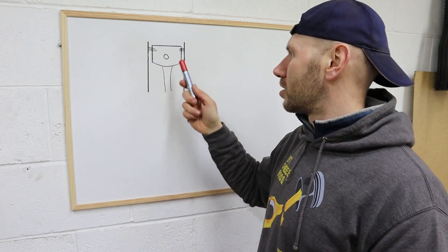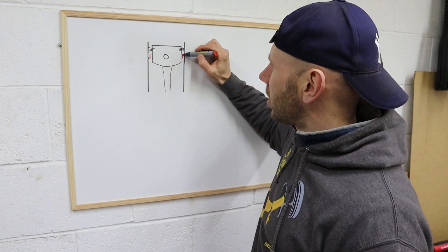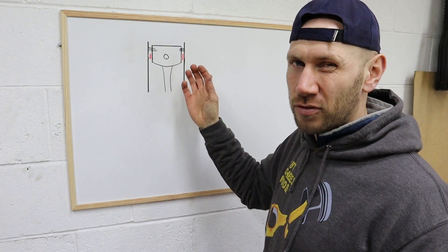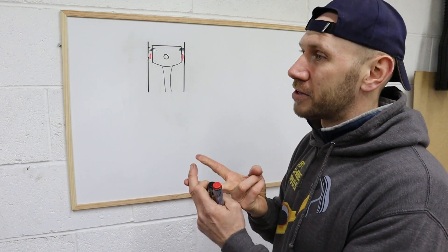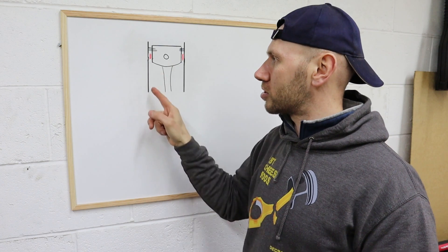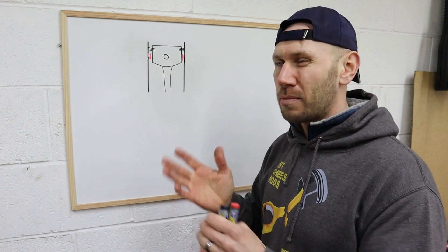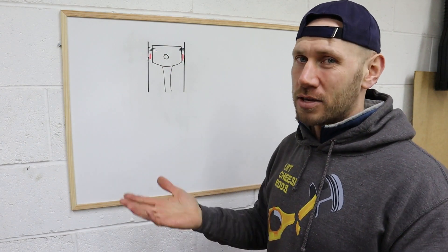At the same time, you want that piston to move freely up and down the cylinder walls, so there has to be a bit of a gap — and that gap is your actual piston-to-wall clearance. Now, if that gap's too big, the piston can move around in the bore and become unstable. That's not very good for your piston rings — you'll be down on power because compression will be down, and down on oil control so you might be burning oil. At worst, the piston's moving around so much that it actually contacts and wears on the cylinder wall, the rings won't seal well on a worn bore, and you might even gouge or scratch it. Piston-to-wall clearance that's far too big is a bad thing.